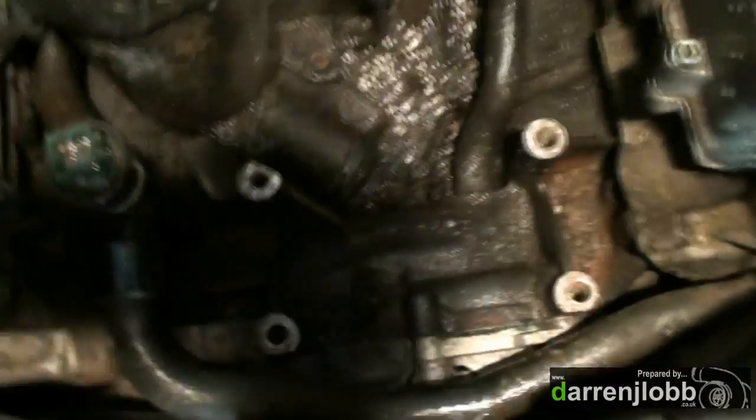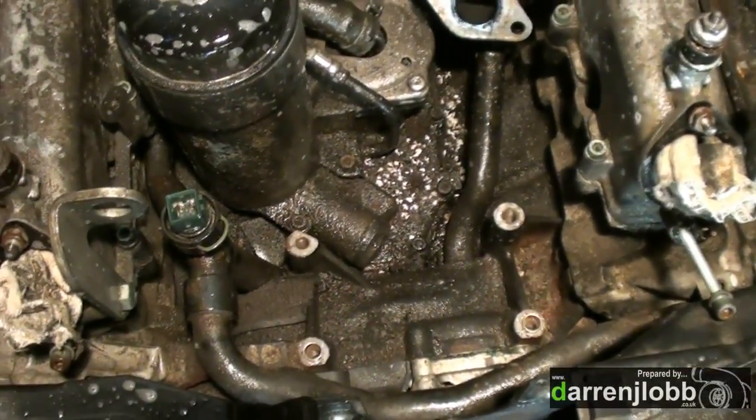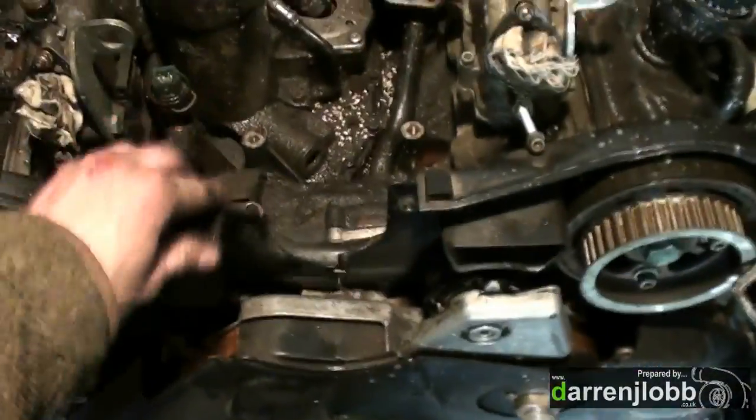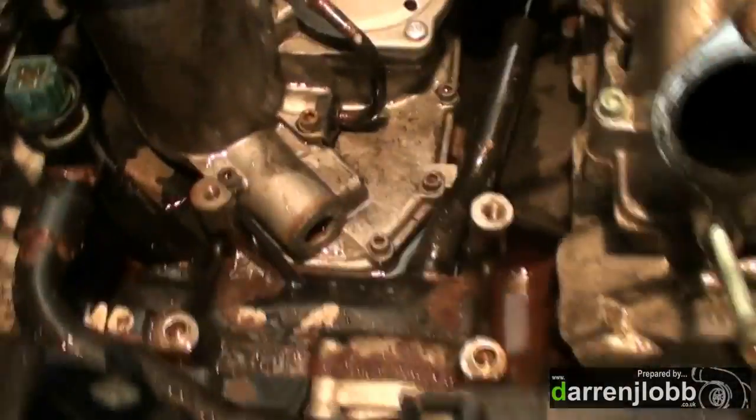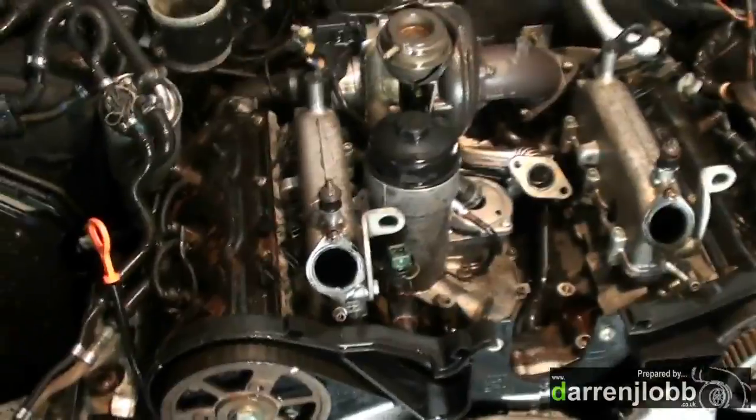Just starting to measure up and make up a mounting plate for the pump. As you can see, the VP44 is bolted down through the bottom studs rather than the front face, and obviously there's nothing to bolt a front face to — it's just plastic — so we're going to have to make up some brackets to base-mount a VE. I've given the engine a bit of a degrease — it's soaking at the moment — I'll give it a blast off in a minute because it's rather grotty. I don't think it's ever been cleaned since it was new.